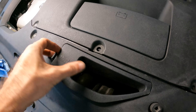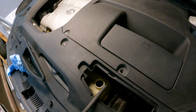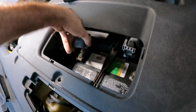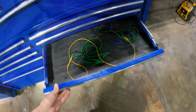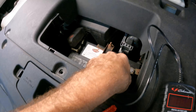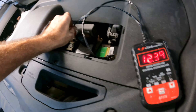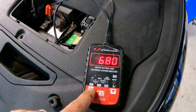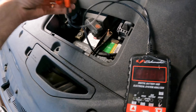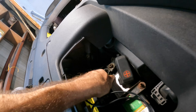Let's see what's in here — coolant looking red color, probably OE, that's okay. Check out our battery terminals — those are tight, fairly clean. I'll go ahead and test it while it's here. We've got an Interstate battery, group 24, 700 cold cranking amps according to the sticker. Let's get our machine attached. We'll test it at 700 CCA.